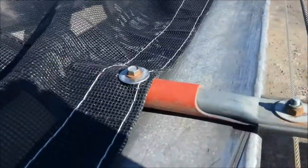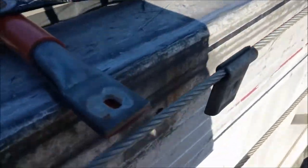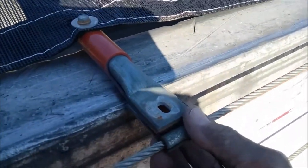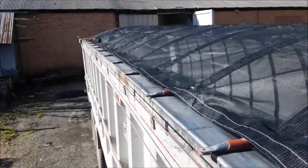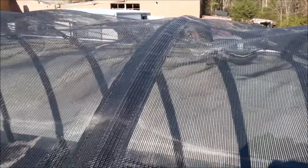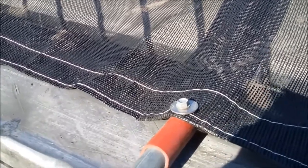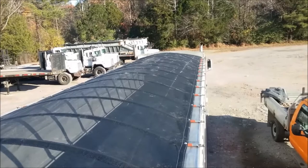I have a couple of clips reattached with the tarp secured. As we run down the cable, I'll bring in each hanging clip and secure it on the bow, continuing that process the rest of the way down this side. On the driver's side, since we didn't remove the bows from the cable, all I have to do is put the screw back into the bow.